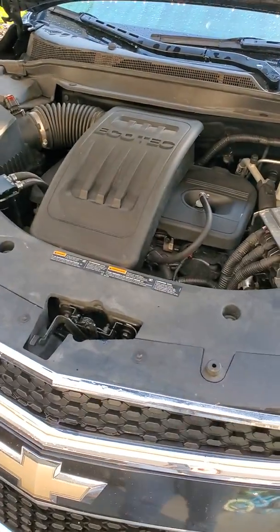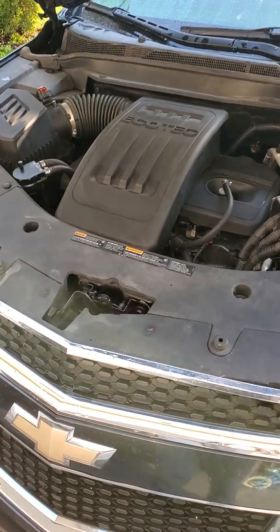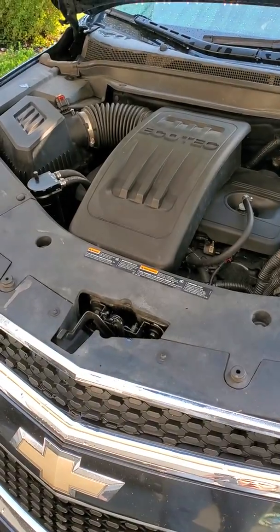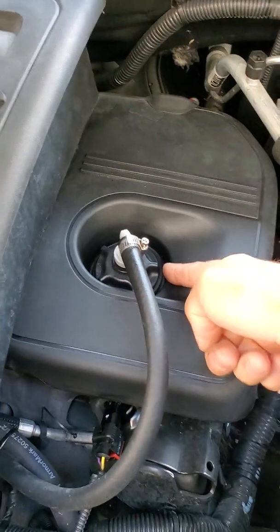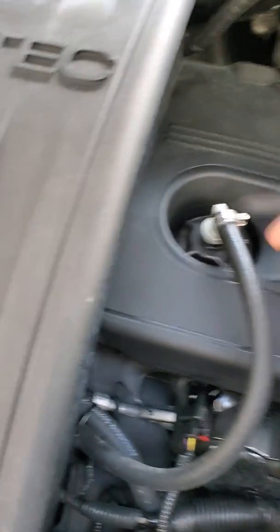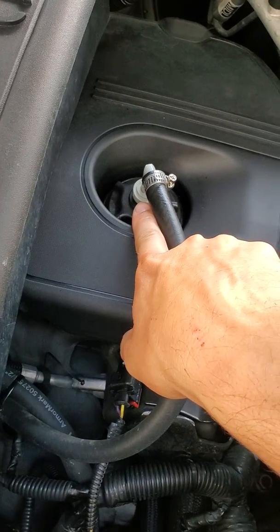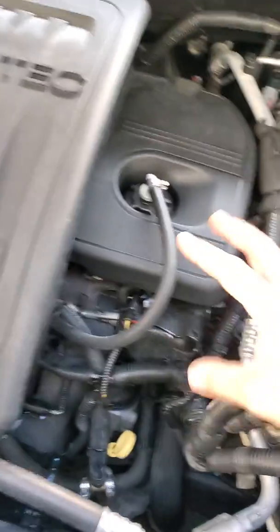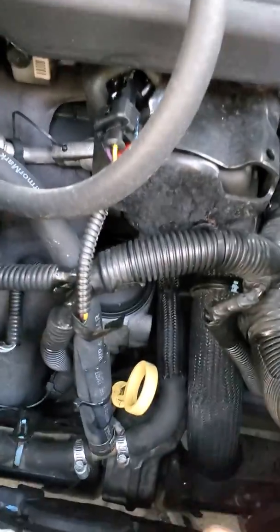But if you caught it under warranty, this will fix the rest of what GM didn't finish. It's super easy — I'll put the parts in the description below. This car has 124,000 miles on it. All you do is buy a different oil cap, drill a hole in it with a grommet and a PCV valve — this is from like a 2.0 or 2.2 liter probe engine. All of this stuff is like $15, some vacuum hose, and then a $25 catch can from Amazon.